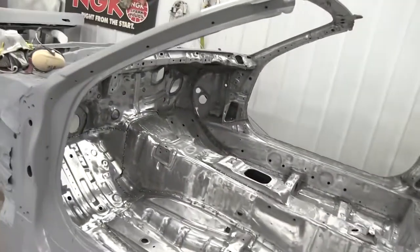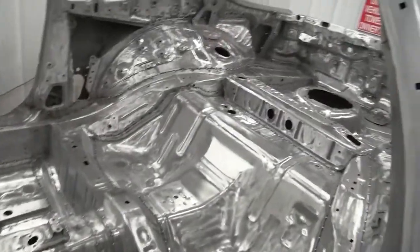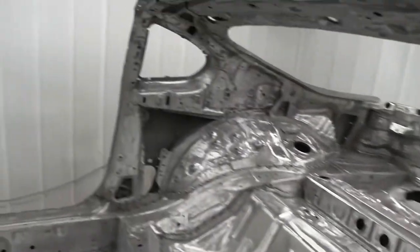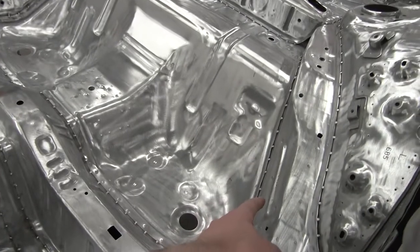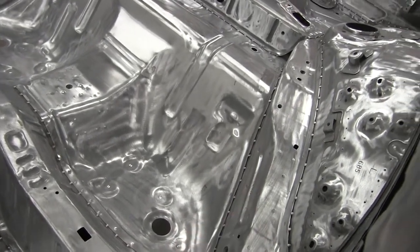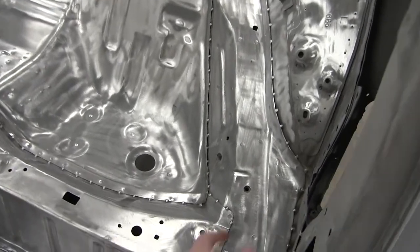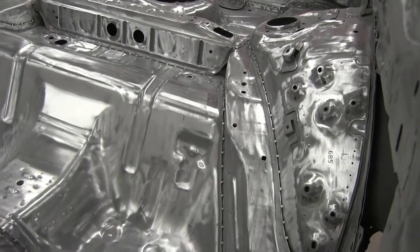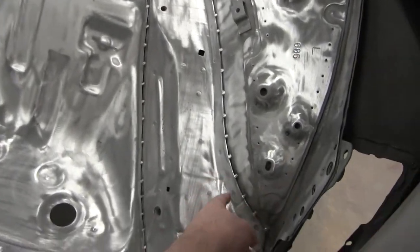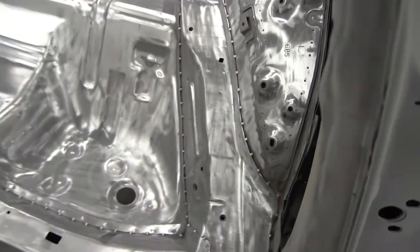All right, so my back is pretty sore, but after a little while, we got the interior stripped down. Now what I'm gonna do is try and seam seal some of the bigger cracks or seams. But the problem with that right now is there's spot welds on all of them. So instead of being able to just put my gun on and then slide nicely, I have to stop each section.